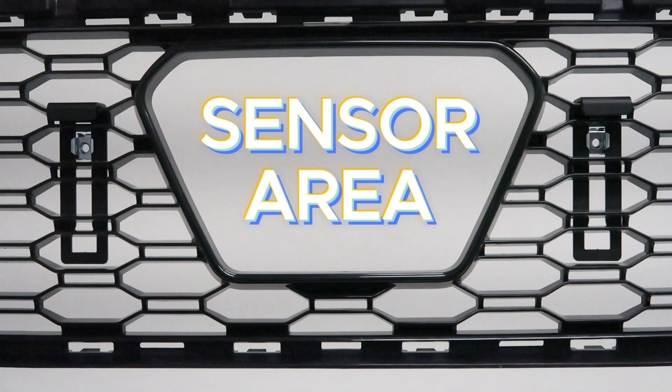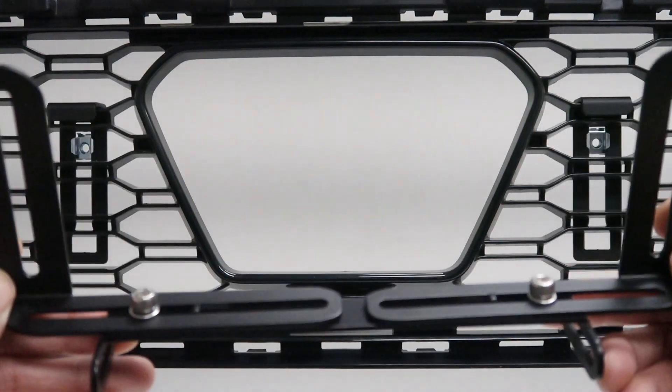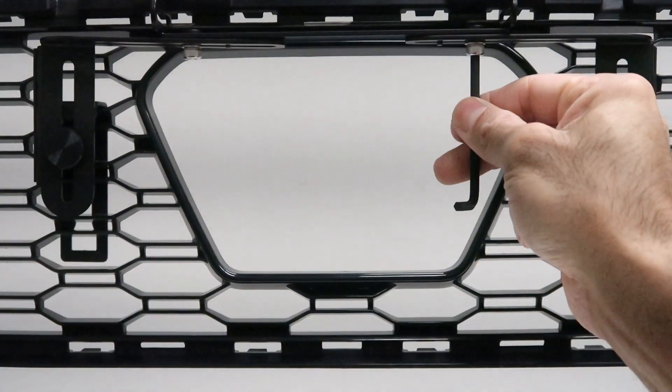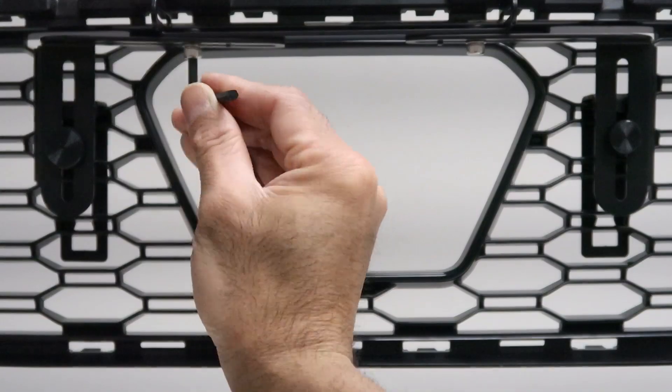For vehicles with adaptive cruise control, two hooks are to be placed equally offset to center. The retainer bracket is adjustable depending on the width required. In this application, be sure to tighten the allen head bolts on the retainer bracket after it is fixed to the grill.